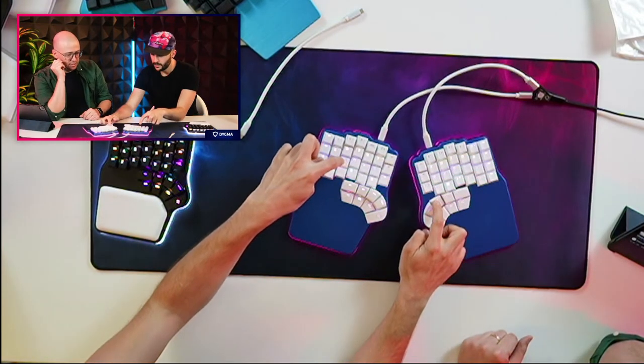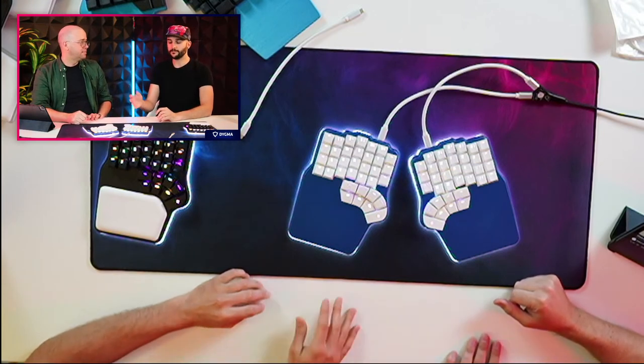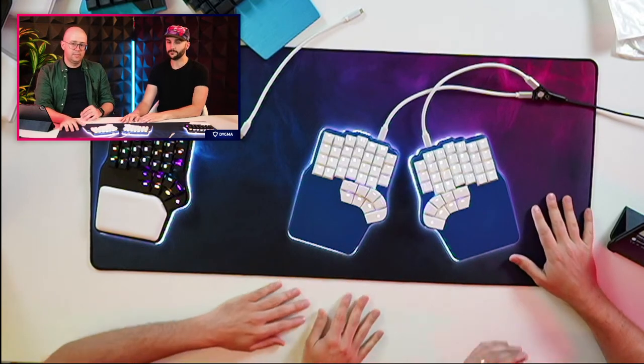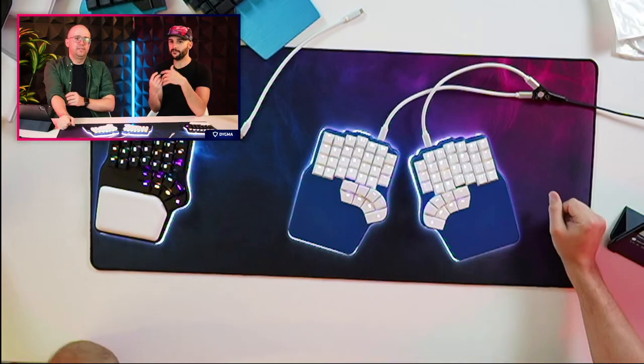But for example, right now if I press 2, it switches immediately, because the keyboard recognizes what you're doing. So even though this firmware is not final, in this case it's working like the final product, so that's fine. It's only the lights that are delayed, actually. Yeah, because we have this wait time where the keyboard has to listen to the next key press, and if there's no key press, then it assumes you're holding it. All my thumb keys are dual function keys, except that one, which I don't really reach. It's an extra thing. This is my number pad. Okay. And I have to go back with that one.